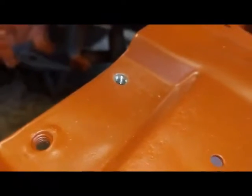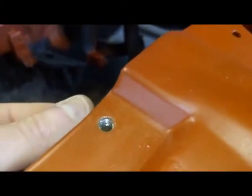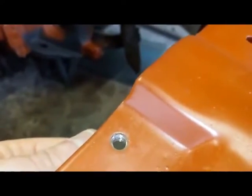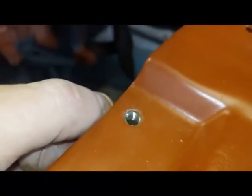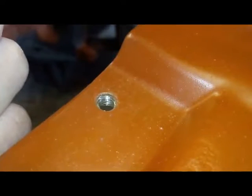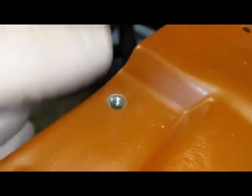Just as I was about to start painting, I noticed a snapped-off bolt inside the car — the top was flush so I hadn't taken much notice. It's definitely best to sort this out before painting. I marked the center as best I could, drilled first at 3mm, then 4mm, then 5mm, and some of the screw fell out. The bits that didn't fall out I tapped with a chisel and hammer and eventually drove a tap through just to clean up the thread again. This bolt is for holding the Mk1 radiator, which I'm planning to keep going forward.